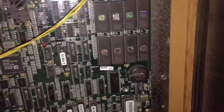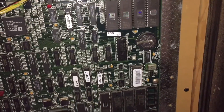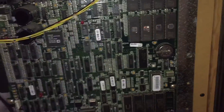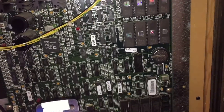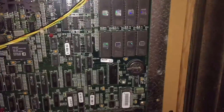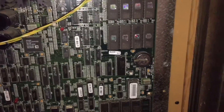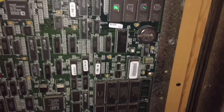What we have to do is get that battery out. It's a BR 2325. You can replace a BR battery with a CR, but I don't think it's good to do vice versa — don't quote me on that. But plenty of people replace their BR 2325 with a CR 2325, and that's what we're going to do here. Then we'll turn it on, calibrate the controls, change some settings like putting it on free play mode, turn the machine off, turn it back on, and see if the settings are saved.